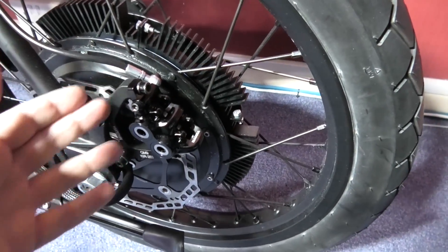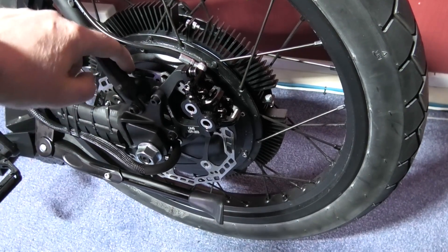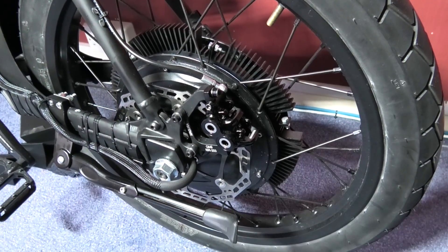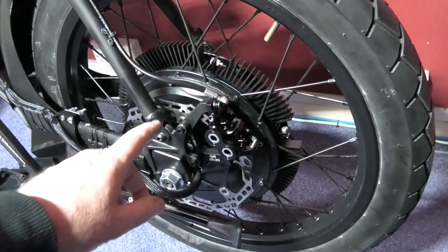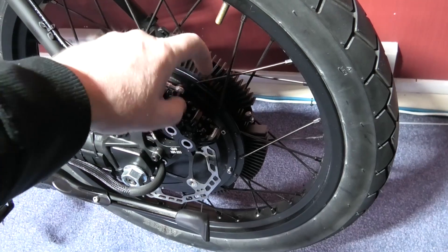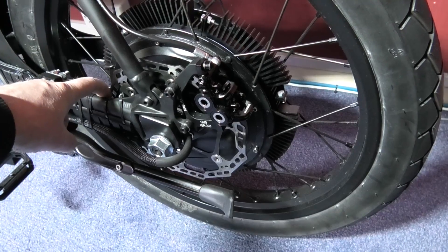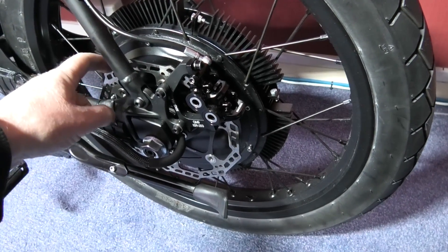I'm not going into details, but I had to do it. Version 2 was an absolute nightmare — if you pull the rotor out it was catching on the frame. On version 2 there was a problem because the disc was actually too close to the motor and there was no clearance on the caliper. So I had to pull it out a bit, but then it was catching on the front of the swing arm. It was a fine line between the disc catching on the motor and catching on the frame, but I've done it now.